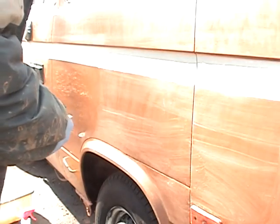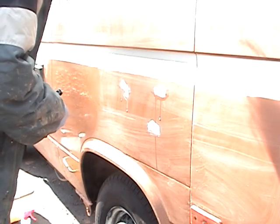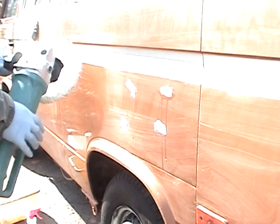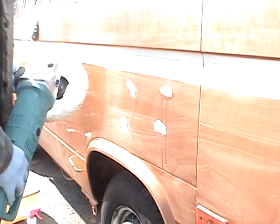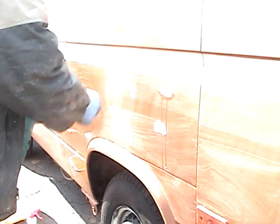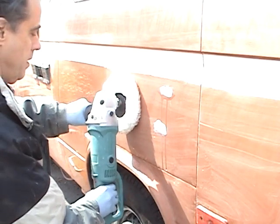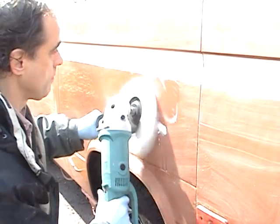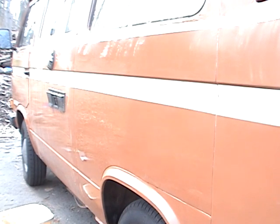Let's put a little of the creme under the car. Now I'm going to hit this with the buffer at slow speed — I've got to keep moving the buffer at all times. I'm going to try not to hit any ridges straight on, because that'll burn right through real quick. We've done this about twice now, still got a little more to do. It's starting to shine up and it really shows the body work. Any imperfection in the paint will now be seen perfectly.